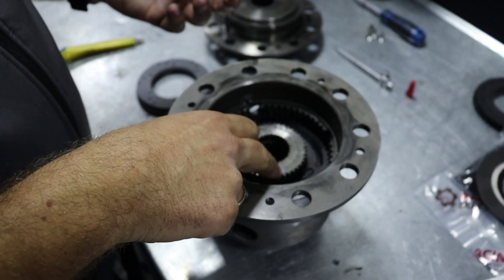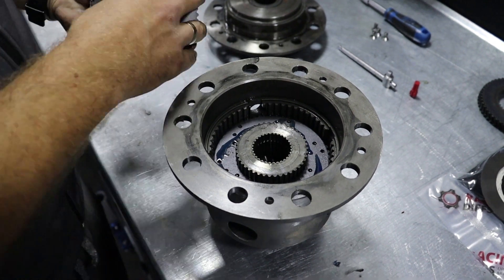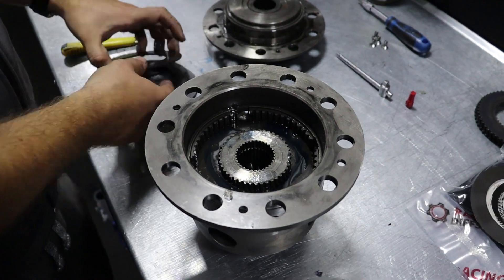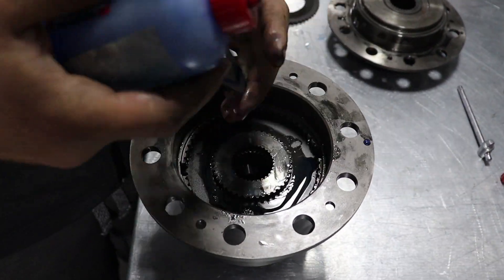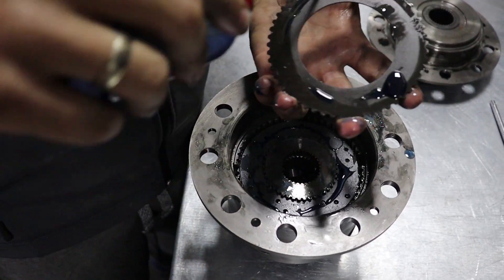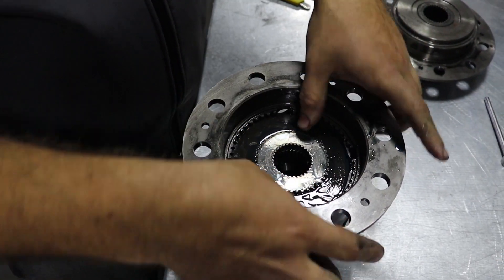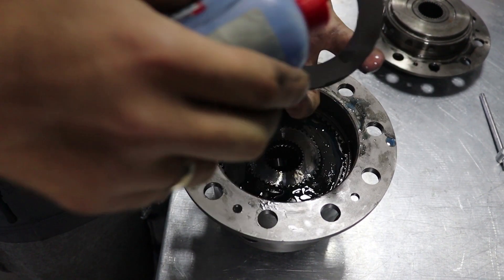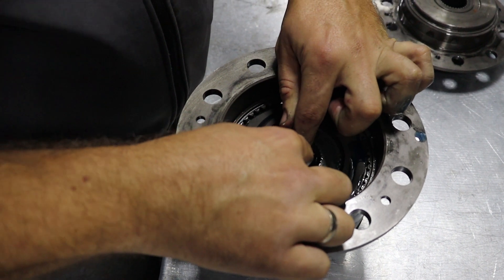Lubrication of all parts is important. The order begins with an outer plate and finishes with an outer plate — that's important. Install them one by one, alternating inner and outer plates. Finishing the clutch stack with an outer plate. As already mentioned, this new set brings one innovation: the preload spring shim goes on top of the stack like this, and that's it.